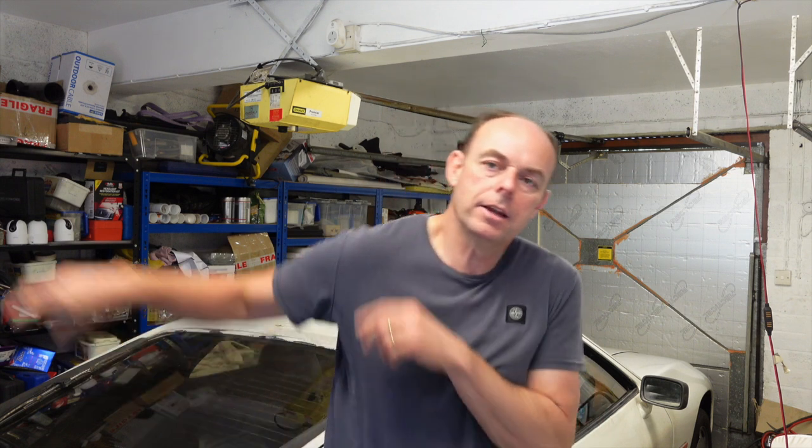Always trust your gut instinct. It is definitely this corner. It is definitely the suspension. The last test, I had my son sitting in the back, listening with the stethoscope to the top of the strut, and he can hear it rattling around. And then I leant back with my arm, I don't know if you can see in the video, and I can feel the top of the strut doing this, and it's in time with the noise that we can hear. So it's time to attack that rear suspension.